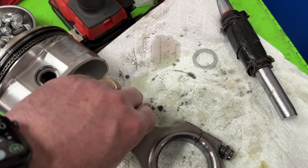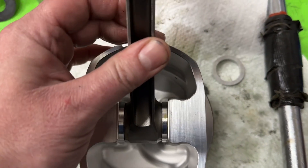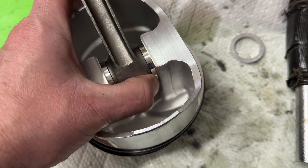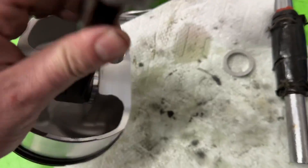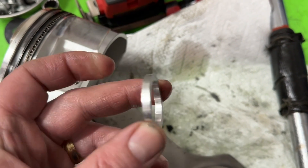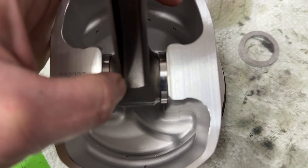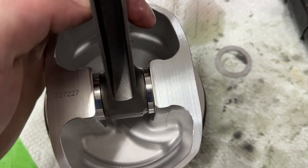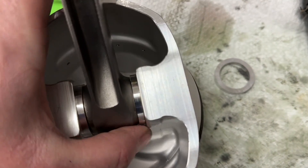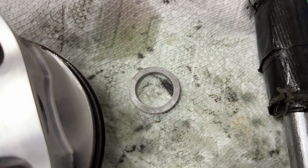But really the point of this video is this — and it's really hard to see in the video. You see these aluminum pieces? These are aluminum washers that you have to sand down to get the correct clearance between the rod and the piston. So when you're watching the video and you're like 'I can't see what he's talking about,' what I'm talking about is right there and right there. That's all it is.